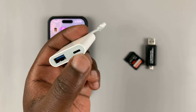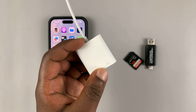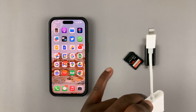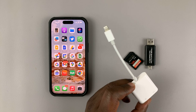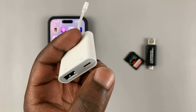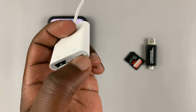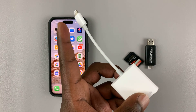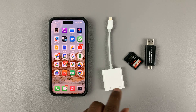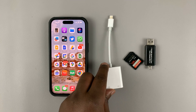It's important to have one with this lightning pass-through, because some devices you connect will give you an error on the iPhone saying that the device requires too much power. That's why this comes in handy — you can add power by plugging a lightning cable here and connecting the other side to power, which will power everything else as you use your accessories.